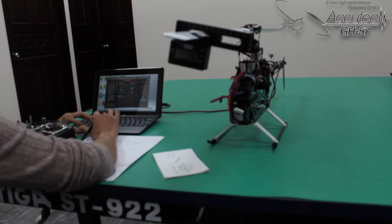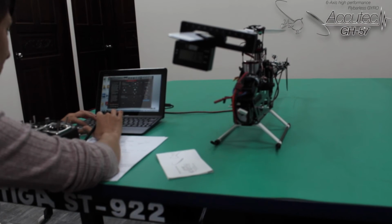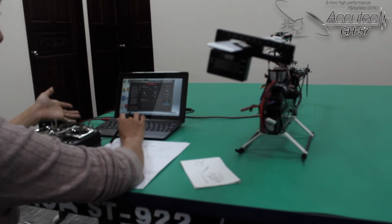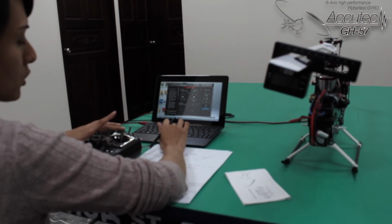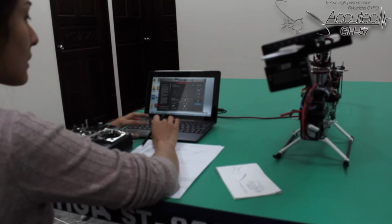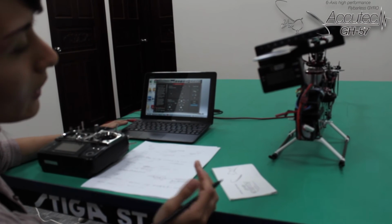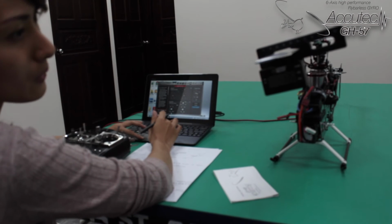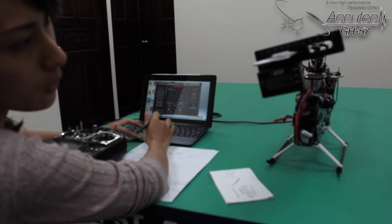So now, after finishing adjusting the upper side, sorry, I'm making that to 0. Okay, after finishing the upper collective pitch, we're moving down to -1. So it's actually very easy. We're just going to pull it down. Okay, still the same. We're going to take a look at the number. It's -13.5. I want to be precise, so I decided to make it 13. Is it working? No. Worse. The other side.